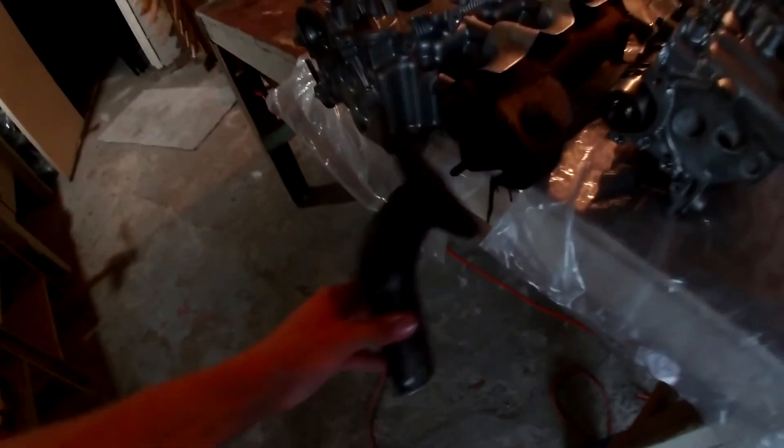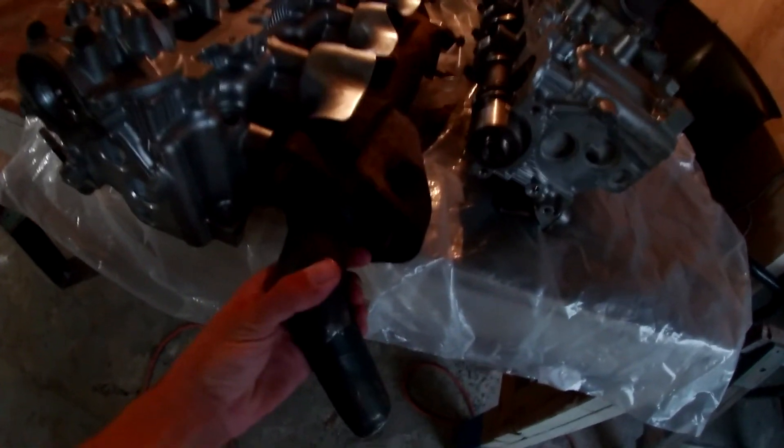This is the passenger side, so it's going to sit over here and that pipe is going to angle downward. The two will have a crossover pipe that goes towards the end of the transmission rather than right in front of the firewall. This is the crossover pipe and that is the end we cut off. Originally it's supposed to sit like this, with the crossover pipe coming over behind the two heads right in front of the firewall. But what we're going to do is flip it around so it faces straight down — fits underneath the truck.